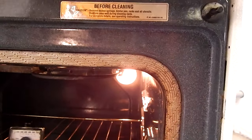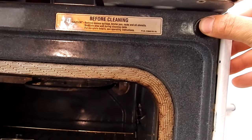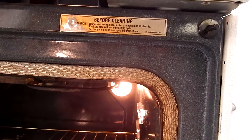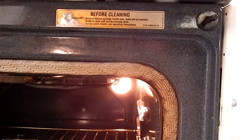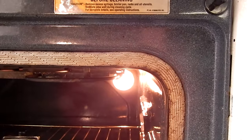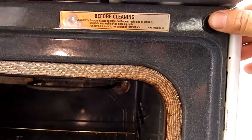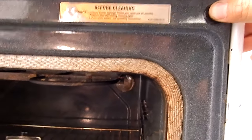Now if you have a good light bulb in your stove, this is the easiest way to check the door switch. If the door switch is not pressed in, or if the switch is bad, the locking mechanism will not lock the door because the stove thinks the door is open. So that could be one of your problems. But if you press that in and your light goes out, then that's definitely not your problem. That's why we tested the lock motor for voltage.